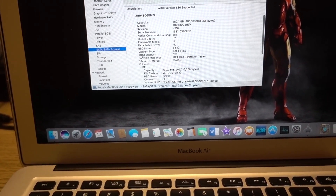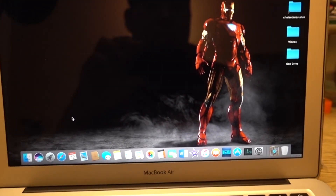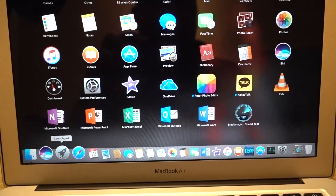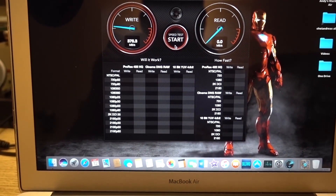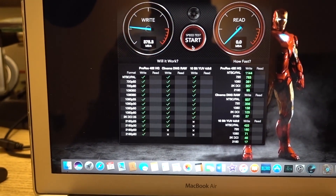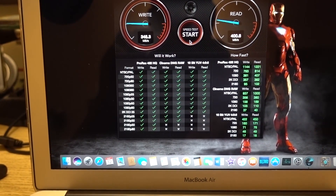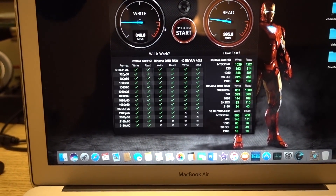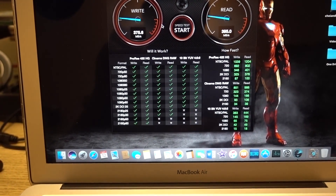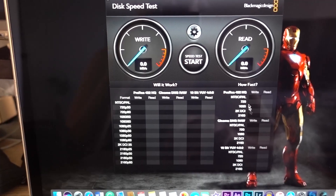After reboot, it says TRIM support: Yes. A regular M.2 with an adapter works perfectly fine in a Mac. This particular adapter did have a little bit of lift, pushing against the back case, which isn't a big deal. Performance is a bit subpar, but that's probably just the Crucial M.2 I got. It has a faster write speed but a slightly slower read speed. Just for giggles, I busted out my MacBook Pro Retina to compare speeds.